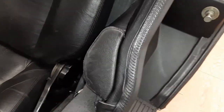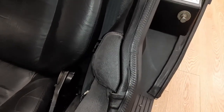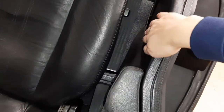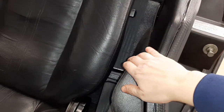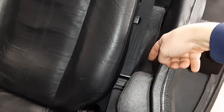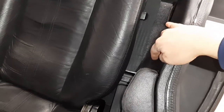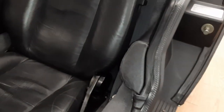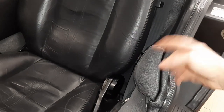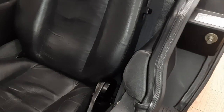I'm going to show you a two-piece armrest extension. This piece right here is what is considered the armrest extension — it's a vinyl interior panel with the leather extension, and these pieces are separated. There are two small screws through plastic that secure this, and when you get in this car without being careful, you sit on these and pop it right off. The factory did have a fix for that, which we'll show you on a later car.